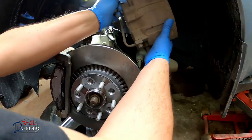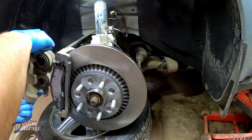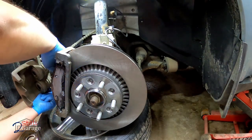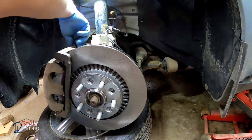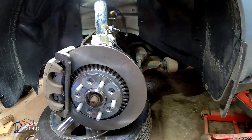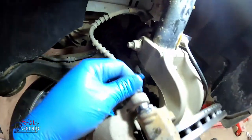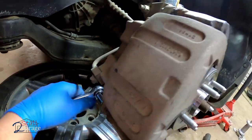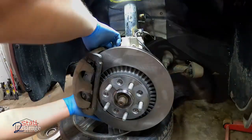All right, let's grab our caliper here. Look at that, didn't even knock the light down. These are flat up again. I'll have to take a look at that when I edit. I don't remember showing you guys this. Boy, it's nice to see those new brake pads on. We can push those all the way up now, right up against the rotor there. There we go. Bleeder valve's always on top. It's our 13. Click there. Click there. All right, so this should be able to move a little bit. It does. Excellent. You can see how it moves a little bit.